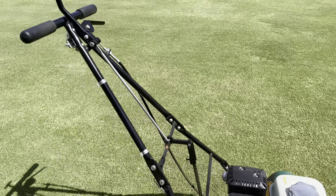That last video clip was from my original video, and I kept it because I did not properly diagnose what was actually wrong with the California trimmer. I initially thought it was a belt replacement, but in fact, research and conversations showed that a belt replacement doesn't typically fix those symptoms. In most cases, when a belt is wearing out, the reel won't continuously spin. What's more typical of a needed belt replacement is when the belt just breaks or you have a loss in propulsion. I wanted to clarify that because it wasn't accurate in my first video.